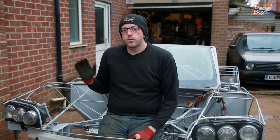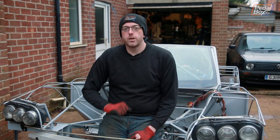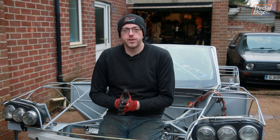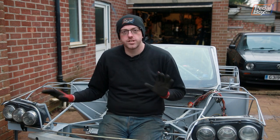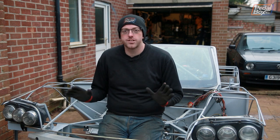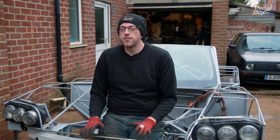That's the fuel lines in, and we managed to get the firewall almost completely welded in, which is really good news. When we get the welder back we can finish those little bits off, and we're going to add a few more odds and ends onto the chassis that we've been meaning to pick up and finish for about three or four months now. We didn't get a chance to test the fuel line properly — unfortunately I've ruined one of the olives so it would have just leaked everywhere. I'll just buy some spares and we'll fix the rest and test it properly in a couple of episodes' time once all those parts arrive.